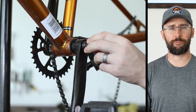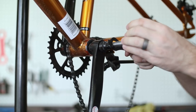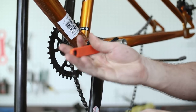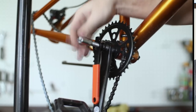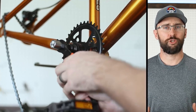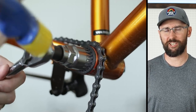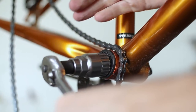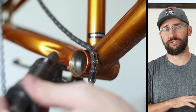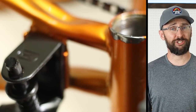This is pretty frustrating. I'm trying to take off the cranks and the bottom bracket, and the threads look horrible inside the cranks — possibly damaged. On top of that, this square-tapered bottom bracket is plastic and my specialty tool doesn't even fit. The splines line up but they're too wide, so I'll have to carefully hit the tool into position with my mallet. Now with the bottom bracket out, there's absolutely zero grease on the threads, and the more I mess with it, paint chips keep falling off the frame.